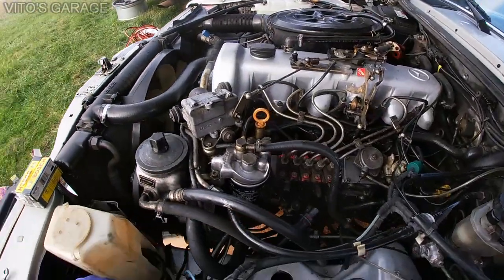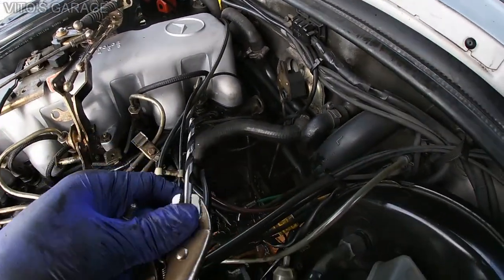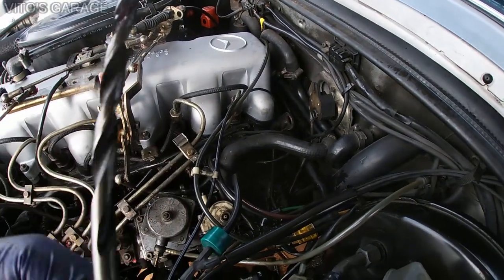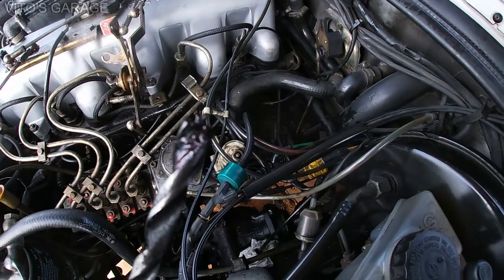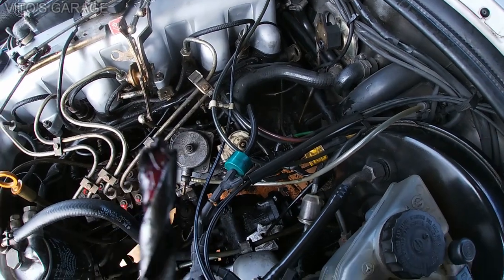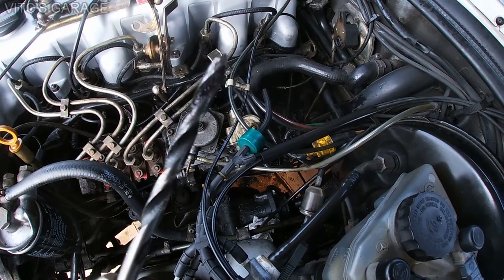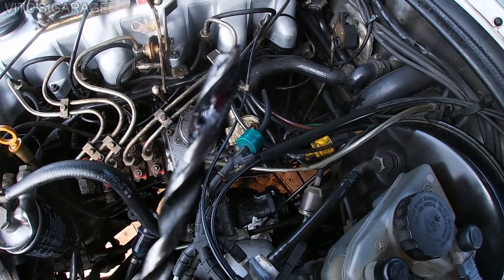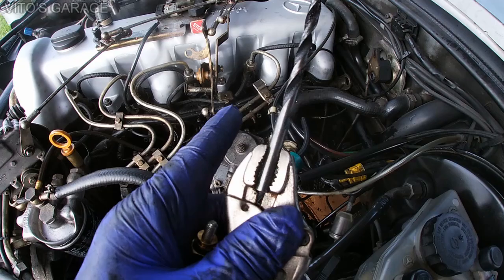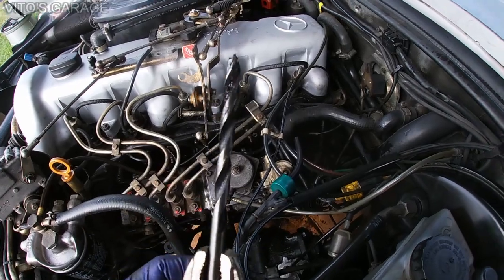So, while the oil filter housing is out, I used a quarter inch drill bit and I actually reamed the hole where the glow plug goes, and there was some carbon buildup actually, and I put some grease right here to catch the carbon buildup. And it's not only that. Before, when I went a couple of rounds in, there was a lot more carbon buildup on that fifth cylinder, and the rest of them are the same way, so I have to use the drill bit and just ream out the rest of the glow plug holes.